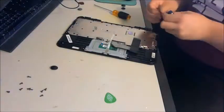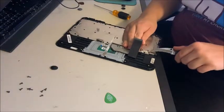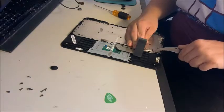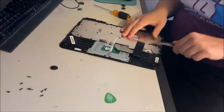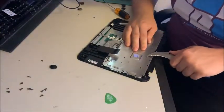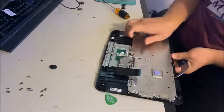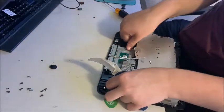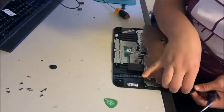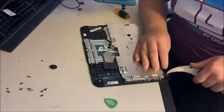Now that you have that off, take your knife or screwdriver or whatever you have available and just start picking at them — be careful. Now kind of press down on your keyboard a little bit. Your metal part should come off just like this, and that's perfectly normal. Just be careful not to bend these front ones up here because these front ones are very, very weak.